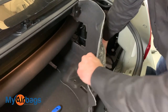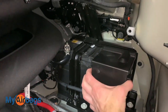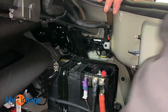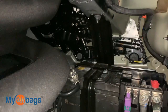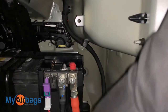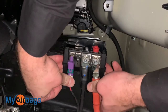Work it down and peel it back to get to the battery. There's one tab right here, another one on this side — press on them, squeeze and pull, and it'll come sliding right off. Right over here is our negative terminal; take your 10 millimeter, loosen it, wiggle it back and forth, pull up, slide it off, and put it completely to the side. Now do the same thing on the positive side, then grab both sides of that plastic piece and work it off.